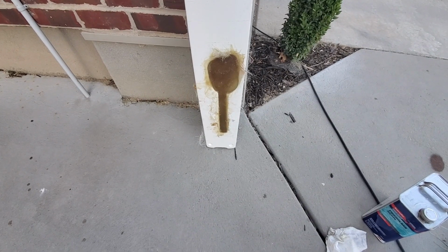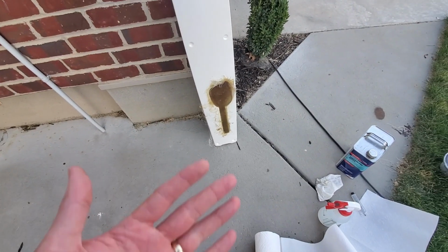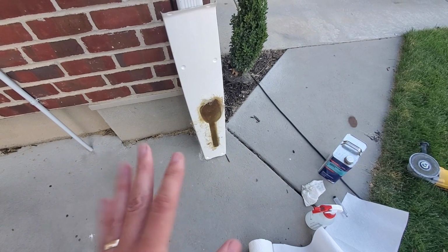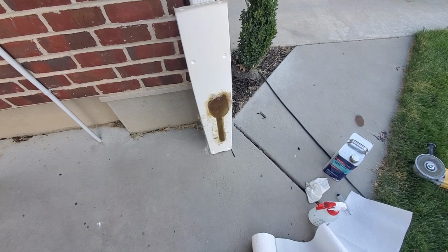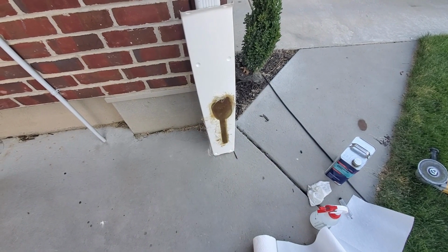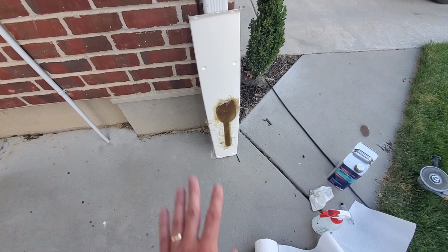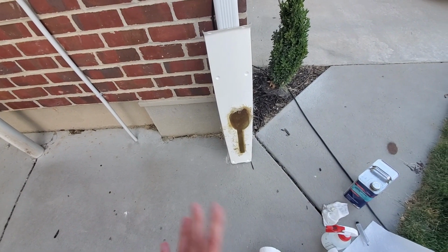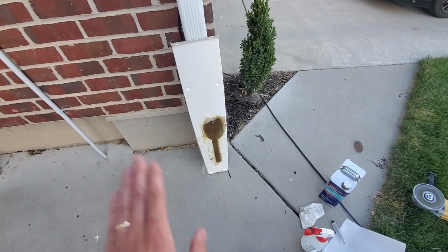All right, I got most of it all in there. Again, I'm a rookie when it comes to fiberglass. So I started on the back side and everything looked pretty good. When I ran to the front side, the back side really started to want to fall away. Not so much from the edges, but just in the middle where it didn't have support. So I grabbed a piece of plastic just to support it, laid those top pieces in, and again, what I thought was going to be the right thickness was nowhere near. So I'm just going to let this one dry and cure up, probably sand it or cut it off in between, create a new good surface to bond to, and then do a couple more coats so it's even there.